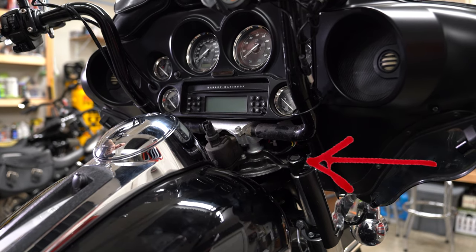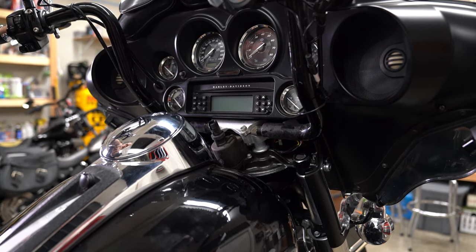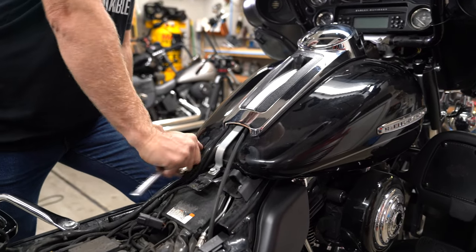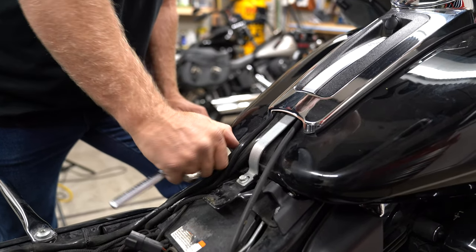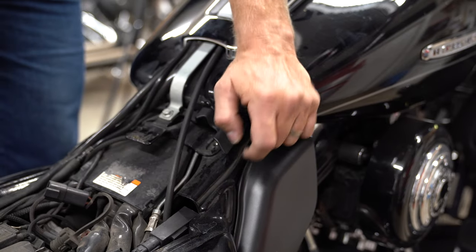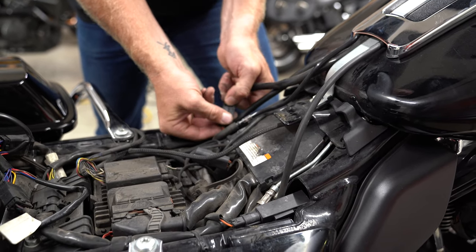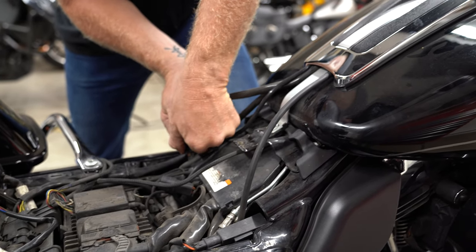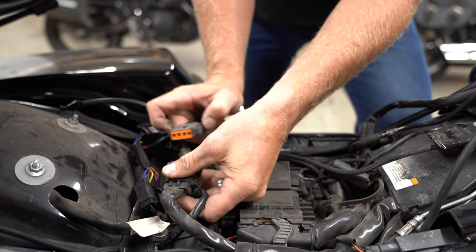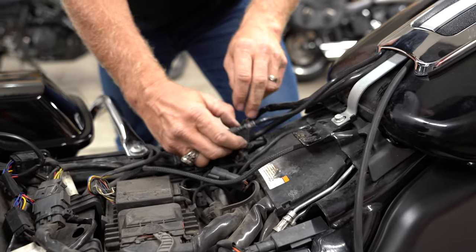Those fork cap nuts are kind of back up in there and they're tight. If you have a fork cap wrench — it's a specialty tool — you could certainly get in there and have plenty of room to get those nuts off. We don't have one on hand today, so we're actually just going to remove the fuel tank because all we have is a box end wrench. We'll get this tank out of our way — it's pretty easy. That's a Torx T40. There are two bolts right on the back of this tank that he's going to be removing. He's got both of those bolts removed off the back. We're just going to remove a few things so we can pull the tank off. Just one plug there — yours may be a little bit different. If you have a 2014 or newer, it will be different. Just look for the plugs that run along the top of your tank. We've got two vent lines — this one just dangles down on the bike, you just pull it out. The other one you can disconnect right up here.